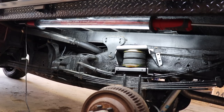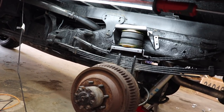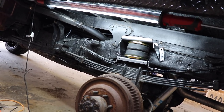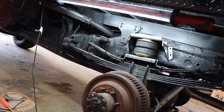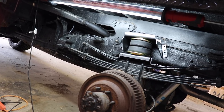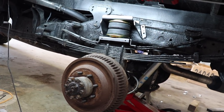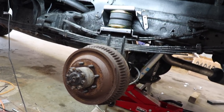We basically got the driver's side airbags now mounted — there are just four bolts on this driver's side. As I mentioned, there's a lot of brake lines and wiring harnesses just on the other side. Thankfully I didn't nick anything. The hardest part is closer to the front of the truck where the gas tank is. With just one guy — thankfully I have freakishly long arms — to reach back there with the wrench through all the wiring and get those nylon nuts tightened was a fun challenge. Nonetheless, it's on there now. I just have to tighten two bolts that thread up into the airbag from underneath, then put the u-bolts on and we should be good to go.